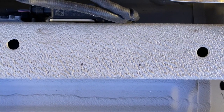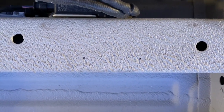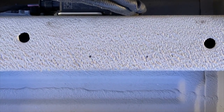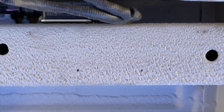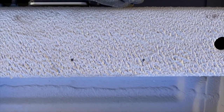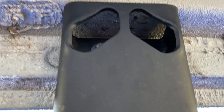All right, here's the locations for where our rib nuts will go. Used a Sharpie to mark so I can see visibly, and then I center punched to start a little dent for the bit. I'm going to use a 1/8 drill bit to start drilling, and then a stepper bit to get to 1/2 inch. And then we'll mount it.